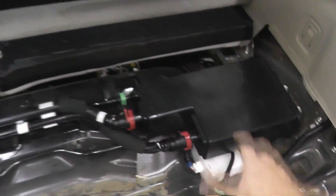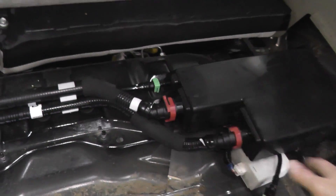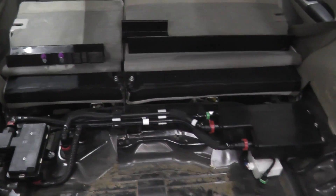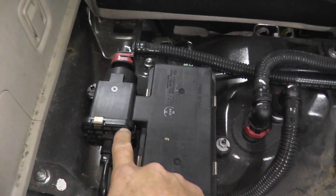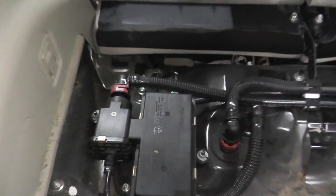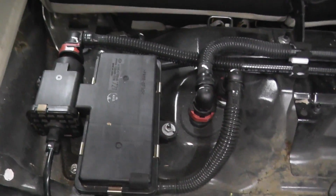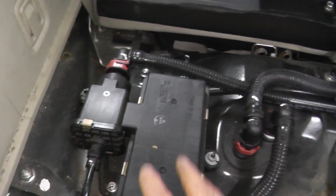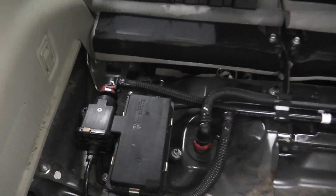Here on the right we have the canister. If you're curious about how to remove it, where these lines go, and what they do, I'll include a link in the description box below. Then over here is our drain valve. This simply sends ambient air — outside air — pumped directly to the canister. That's all it does. There's also a filter here, and the filter is not serviceable. The best way to show how to test everything is by removing it from the vehicle.